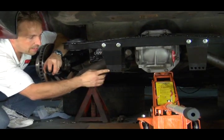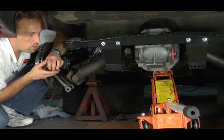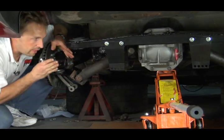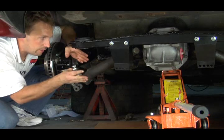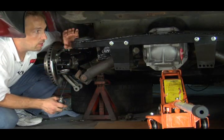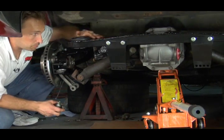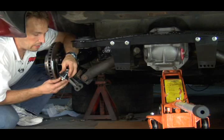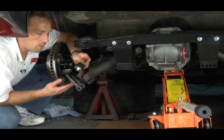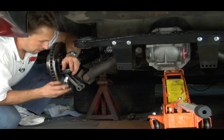These get mounted so that the bottom of them tilts in towards the front of the car. When installing them, you want to look at it from the side and see that they lean towards the front of the car — if you've got that, you're in the right direction. Once all that's set up, we bolted it back to the differential. While we had the differential loose, we went ahead and replaced the front differential mount with a new Vet Brakes and Products polyurethane differential mount, which is in place now.